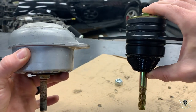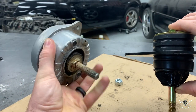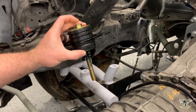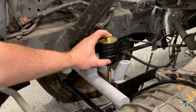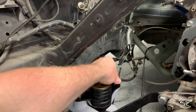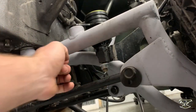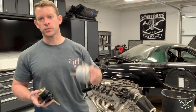Here you can see a quick side-by-side view of these two mounts next to each other. Both have the same outer diameters and measurements, however this one is much more compliant and prone to fail, as you can see. This process wouldn't be complete until I show you how these mounts fit on an actual car. This is a Porsche 6-speed transaxle and we're bolting it to my custom subframe. That's three bolts — it's fully installed and holding the weight of this heavy transaxle. Now that we have some new trans mounts, these old Porsche ones can go in the bin.